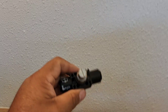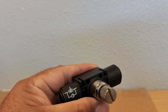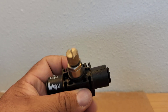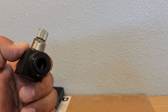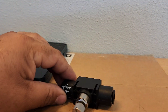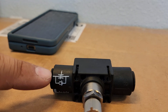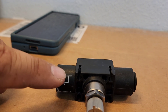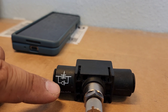For those of you who are not sure how I did this or what this is — this is a flow control valve. I just wanted to get a close-up of basically how this works. This is a three-eighths in, three-eighths out. Right here at the top you can even see this little schematic. Basically, this is telling you you've got the line coming in, and up here at the top there's a flow control, and down here at the bottom you have a check valve.